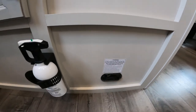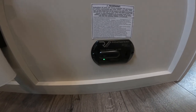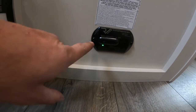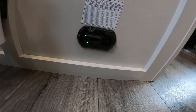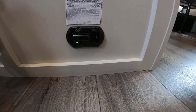Another important piece of safety equipment is your carbon monoxide propane gas alarm. You'll see there's a green light on the front, indicating the system is operating properly. Just above that light there's a little button you can press — the light will turn red, you'll hear loud beeps, then it'll go back to green if your system is safe. It's important to note that fresh paint in and around the sensor can set this off without there actually being a reason to alarm.